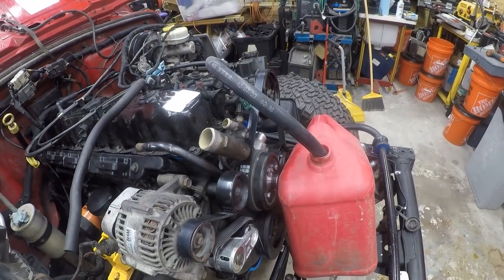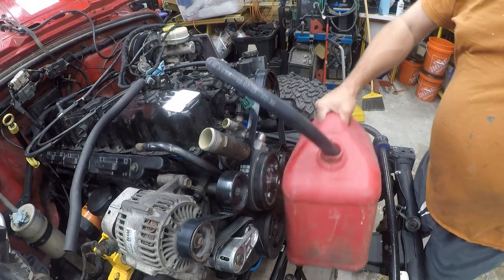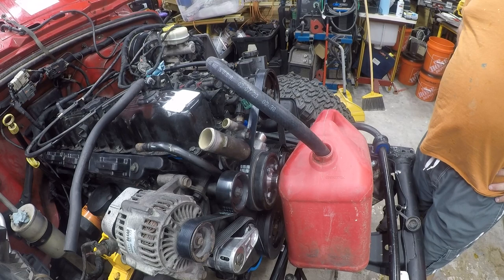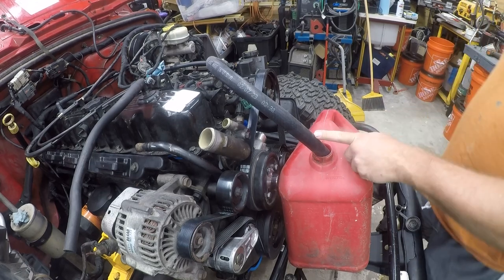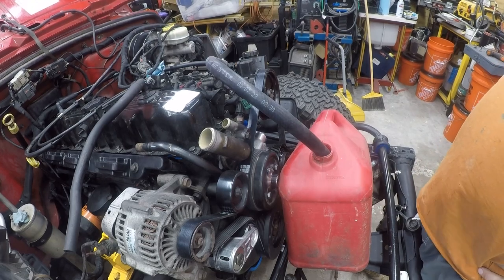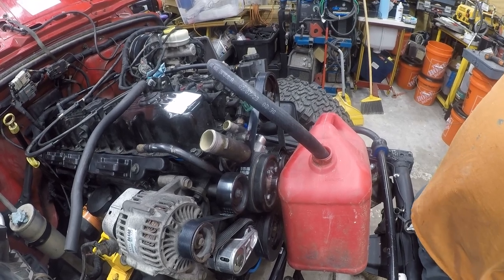Okay, that's it — let's stop torturing the fuel pump. We've gotten all the gas out that's gonna flow, and at this point we're done with this project. I'll safely dispose of this gas. Turned out there was about six gallons in the tank — I thought it was a little more. There you have it: this is the easiest way to get the gas out of the tank of a TJ — use the fuel pump. If you did use cheap water hose that's not rated for fuel, I recommend you throw it away. The gasoline will eat this rubber over time, so that's a really good reason to get rid of it. Thanks for watching — I hope this was helpful.